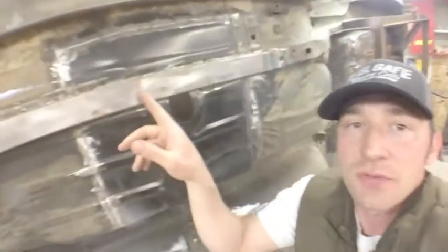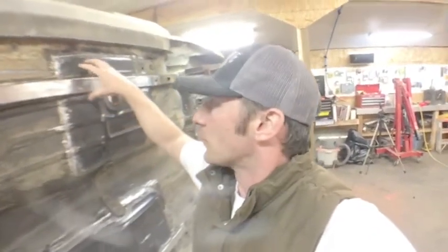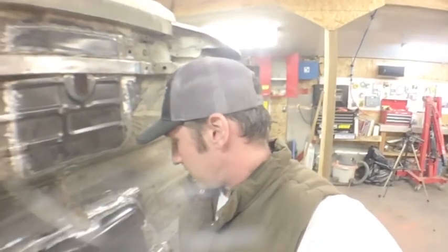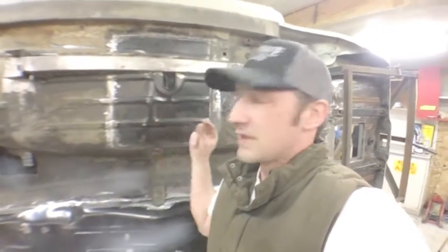I've got the welds. I haven't really ground any of these welds yet, but you can kind of see where they're in there in the bottom of the pan. It's really tricky when you're welding a lot thicker steel to sheet metal. You focus the weld right on the thicker part rather than the thinner stuff, and then blend it in as you go. You can kind of rock it in there. I've had a little bit of practice, especially when you're dealing with older metal versus newer metal. The older metal has porosity in it — it really has to get a lot cleaner, whereas the newer metal is really easy. You just clean it up and it doesn't take anything to weld right to that.